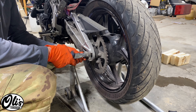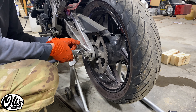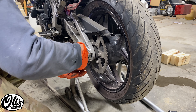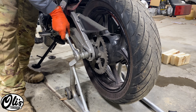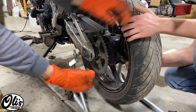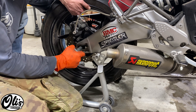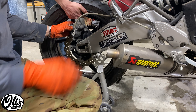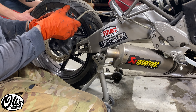Time to replace the rear sprocket. To remove the axle we simply need to undo this cotter pin right here. Remove the rear axle nut and place it aside. Carefully remove this rear axle. Then we can slowly drop out the tire, get rid of the rear brake here — it just slides backwards and out like that — and then we can remove the rear tire.